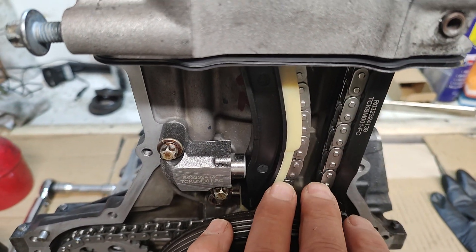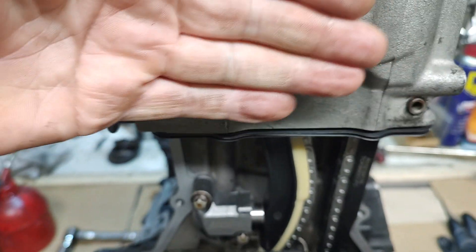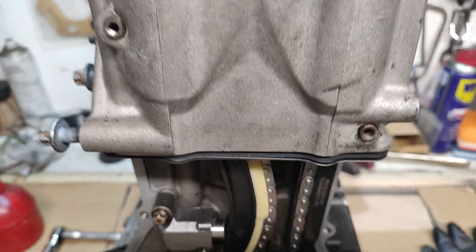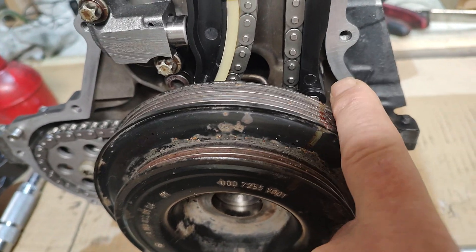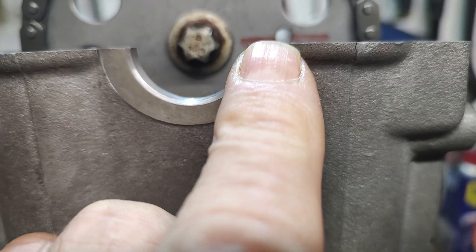So the timing was quite easy to set up. It's very easy to see when number one piston's at top dead center — you can just run a straight edge across the top of your piston, put the pulley on, turn it, and you'll see the piston lifting and lowering. Get it right on top, that's top dead center. Then loosely fit your timing cover, make sure the little notch is lined up with the notch in the timing cover — it'll be pointing to 12 o'clock and halfway down on the half moon. It's really very easy to time this engine up.